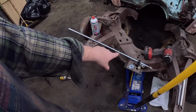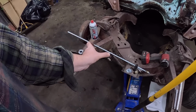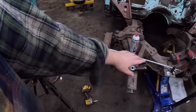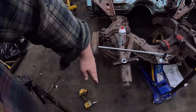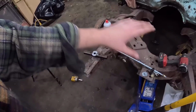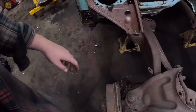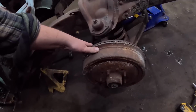We're going to then loosen the nut, essentially expanding the spring. So instead of taking it apart at the knuckle, we're going to take it apart at the lower control arm, and it's going to do this. This will all stay the same, and it'll fold out. We'll get the spring out, 2 bolts here, and we'll take it off as a lump. We will need to take the steering arms, I believe, off. But we'll do that at a later date, or maybe later in the video.